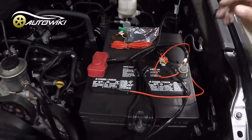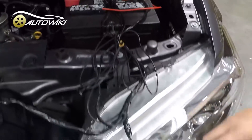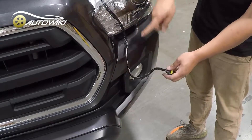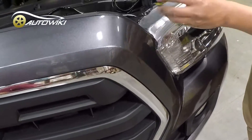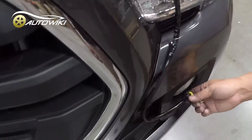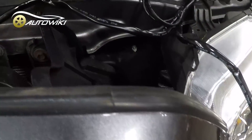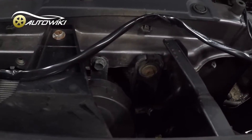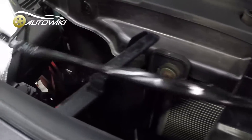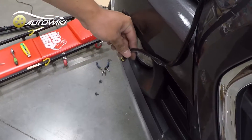Here I'm going to explain how to plug in this harness. If you go down here you'll see the plug — follow this plug; of course it will go behind the headlights. You basically just fish down there with your hand. This harness goes across the truck and down to this harness, which will plug into the fog lights right here.